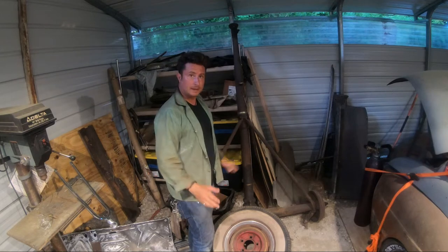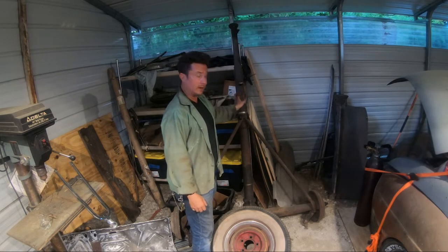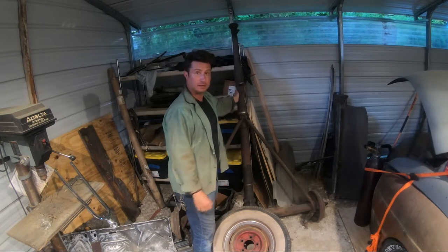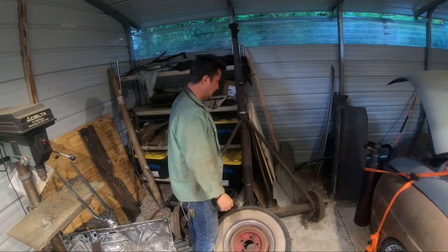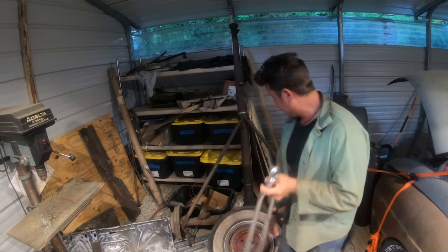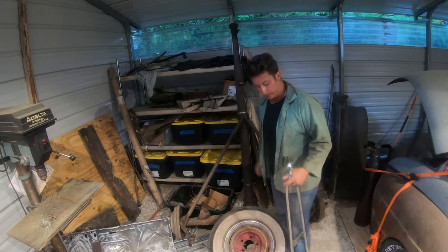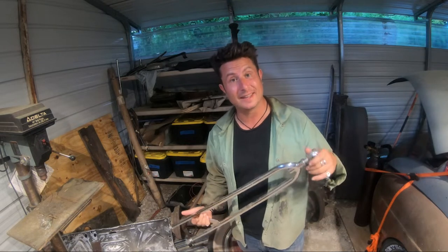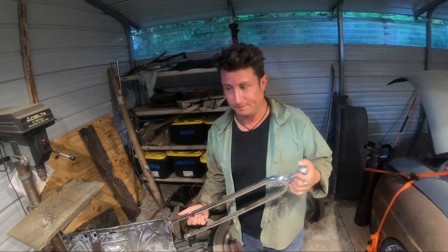Ladies and gentlemen, the torque tube. It's my understanding that it's called the torque tube not because of the torque of the drive shafts on the inside, but rather it's a solid piece that keeps the torque of the rear wheels from spinning the axle backwards. This functions, among other things, as a huge lever. We don't have that anymore, so we've got to do something else. That something else in our case is going to be hairpins — radius rods, whatever you want to call them. Technically these are rear radius rods, kind of the rear version of Ford's wishbones. The other option on a rear end like this is a four-bar suspension, and I'm not going to get into that because I don't fully get it.